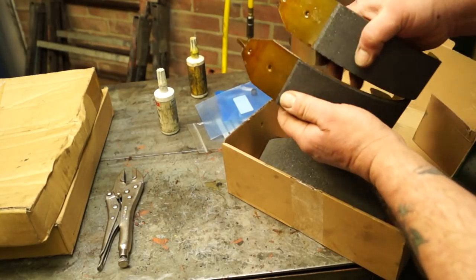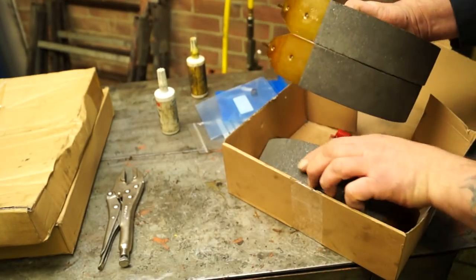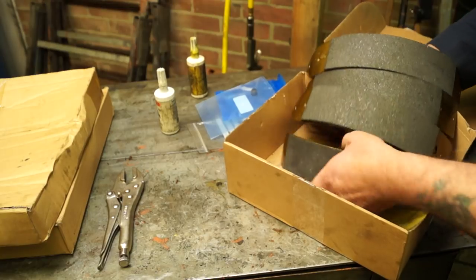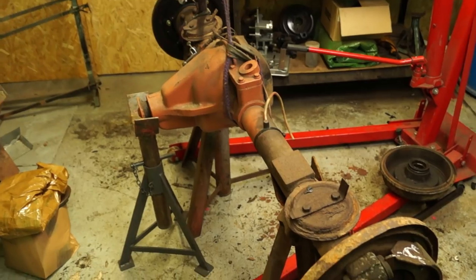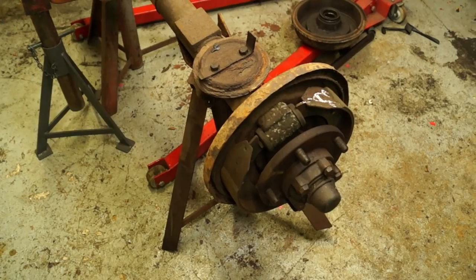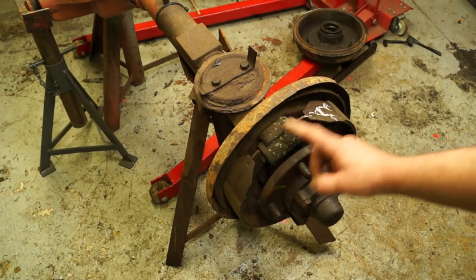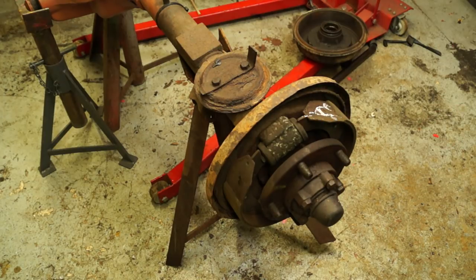You can clearly see here that there are leading and trailing edges. Now this is a big point you've got to remember. I'll strip this axle down and what I found was two trailing edges and two leading edges. So perhaps the guide thought these are just left and right hand pairs. Obviously he gets the squirting rocket award for this, because you can see you've got your leading edge and a leading edge on this one as well — which is completely wrong.